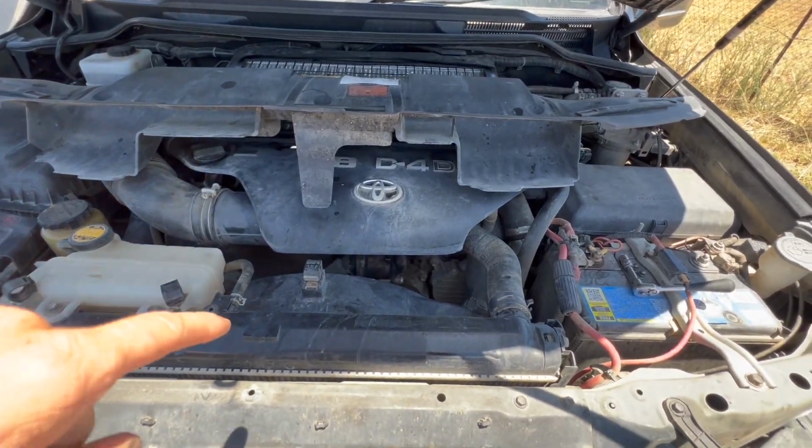In our travels up the Gold Coast, going up and down the highway a fair bit, round roundabouts, lights, all that sort of stuff, what I noticed was even with the engine tune, gearbox remap, I've had that in for a couple of years. I know how it performs. I know how it drives. It wasn't as snappy. It wasn't changing gears like it should change gears. Just that little bit of extra engine load on it, just from the fan getting driven, it's completely changed how the vehicle drives. And it was just that load of the fan being on all the time.